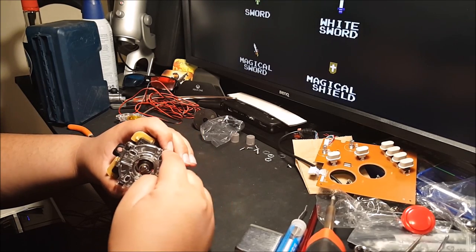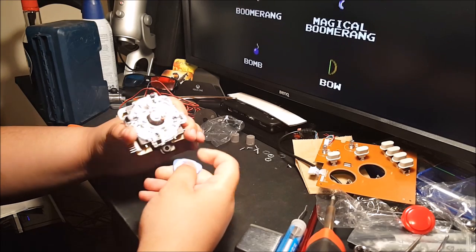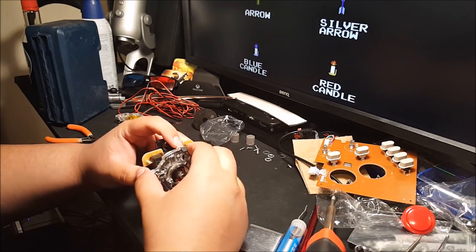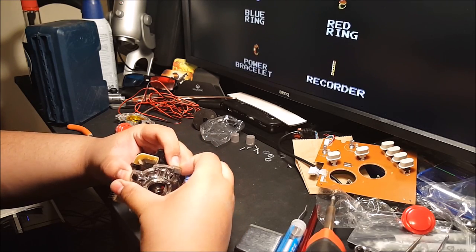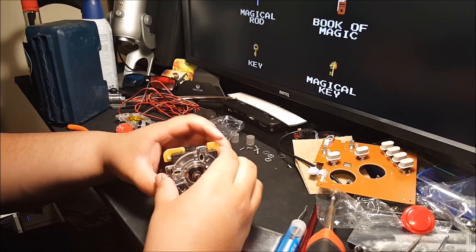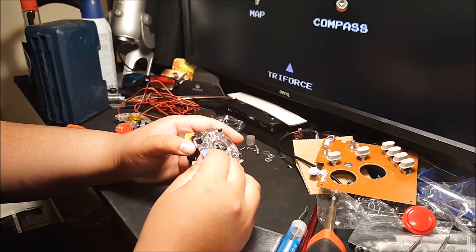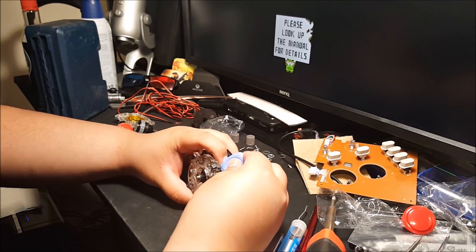Kind of pry. Push that. It's going to push up a bit, and then pry it up and kind of hold it, and then get to the other tabs, basically. The first time I took this off, it was a bit stiff. This time it should be a little bit easier. You want to be careful with this PCB. It is kind of brittle, so you don't want to apply too much pressure right there, because you can break it, and then you've got to buy a new part, which is expensive and takes forever to come in.